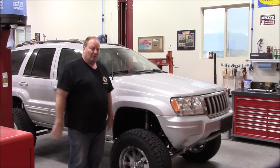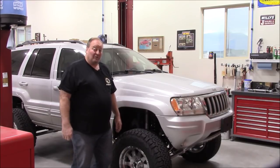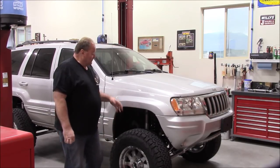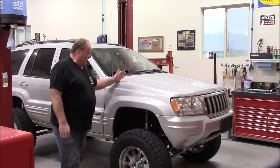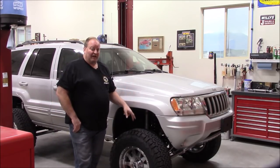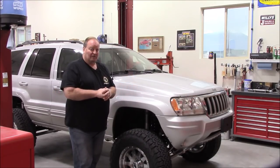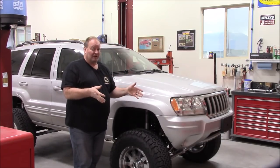We had some other things going on, but for the better part of probably two and a half to three months, I'll bet we've been working on this in the evenings and on weekends. So just to give you a little overview: it's a WJ that we put my old Dana 44 JK front axle in — the housing anyway. When I built my Pro Rock a year or so ago, I bought a blank housing and took all my internals and put them into that Pro Rock.